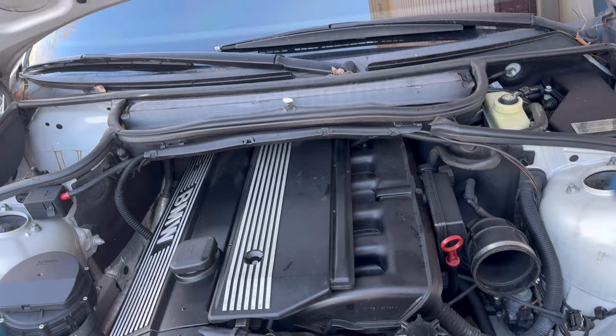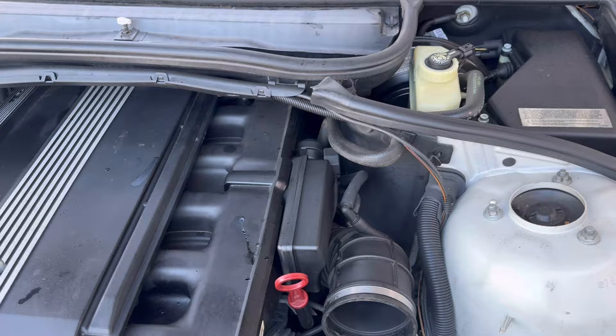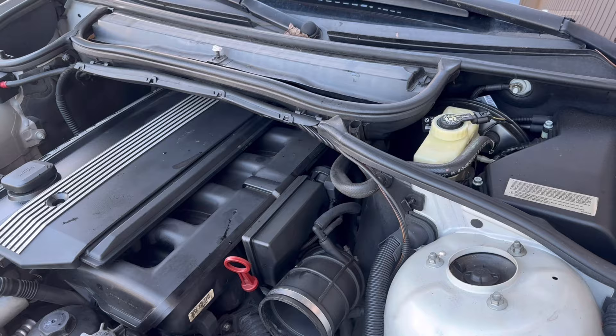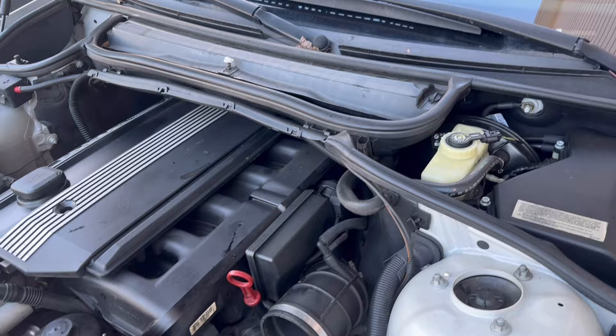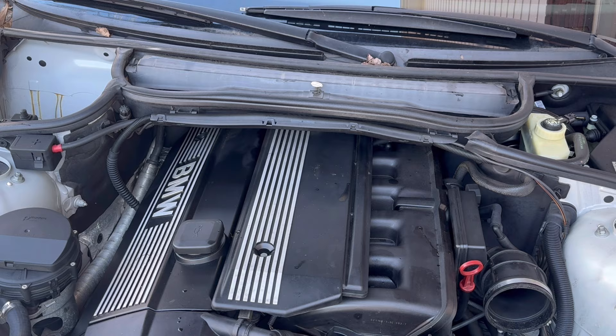We're going to have to pull this cabin air filter housing — that's pretty easy. Get these beauty covers off, pop this corner plate off, that gives us a little bit of extra room. Take the DISA out, take the air tubes off. Taking the intake off is not the hardest thing in the world, but it's not the easiest either. First time, you'd probably get it done in under two hours; I can probably do it in about an hour. Let's grab some tools and start wrenching.